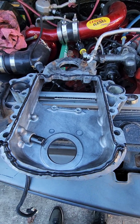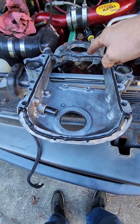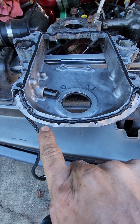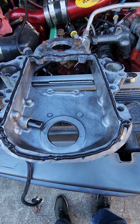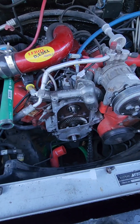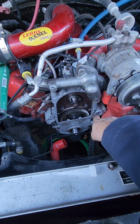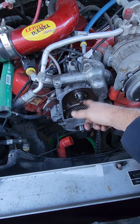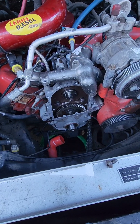Just a quick clip — I've got everything cleaned up and I've put the gasket sealer, the black RTV, on there with a thick bead all the way around. I'm waiting for it to tack up just a little bit. From here on out it's just the reverse of what I showed you — timing cover on, everything torqued down, shield back in, getting ready to put the timing gear back on.